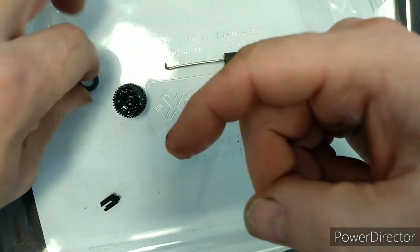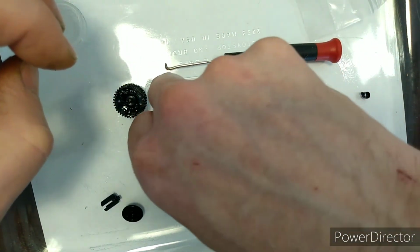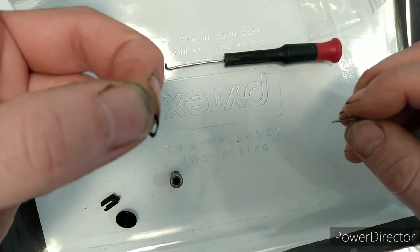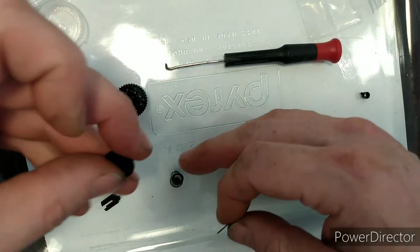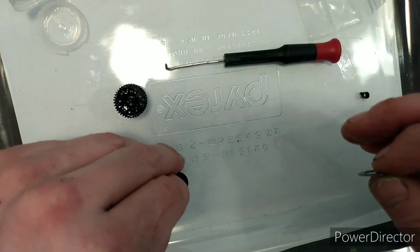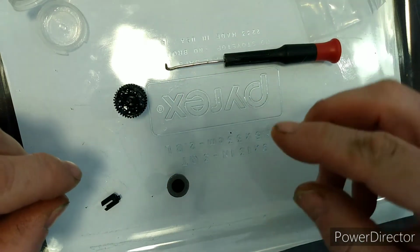I really think I should have applied some grease to that other diff ring. But I think there's enough on the balls right now that after we slowly begin to rotate it after we get it together. Doggone. See what I mean? Do it in a tray of some sort. Okay. Again, we're going to check, make sure we put the spring in the right direction. And then we put the Diff Hub on. And then we put the diff ring on, which we greased. And the grease is kind of sticky now. Kind of getting there.